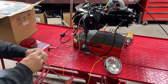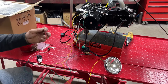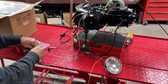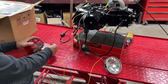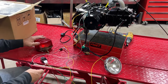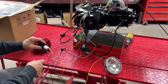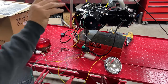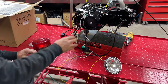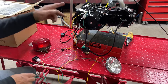The last wire is the red, and I've done the same thing — put an eyelet on it so that it could go to a battery to charge a battery. We're not going to plug that one in. The other one I put a female so that I could plug into this taillight, and then the ground wire on this taillight will need to be grounded with the rest of our system — we're going to put it in this alligator clip. So: regulator red wire — one would go to a battery, one I put to the taillight. The yellow went up to the engine and one to the headlight. The white went straight to the engine. The green ground: one went to the headlight and one went to the taillight and to the engine itself.